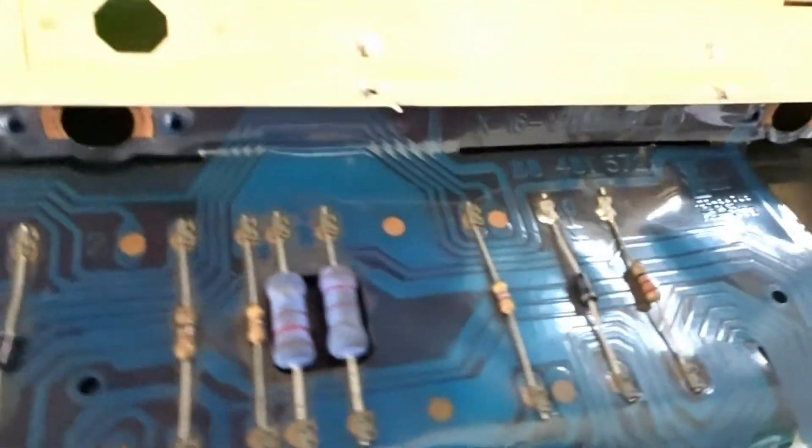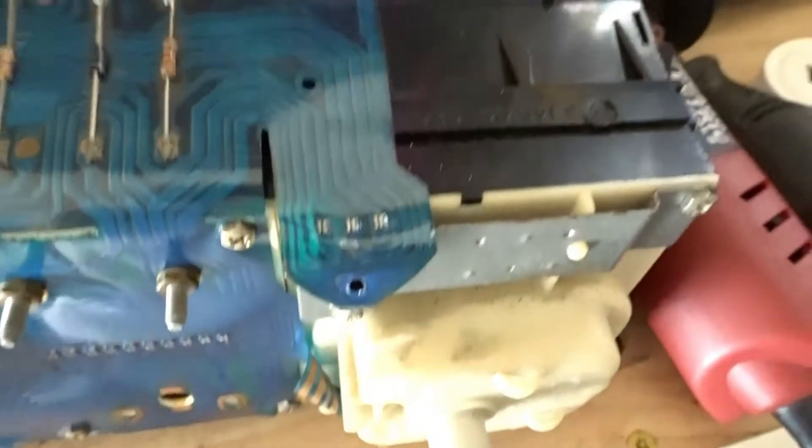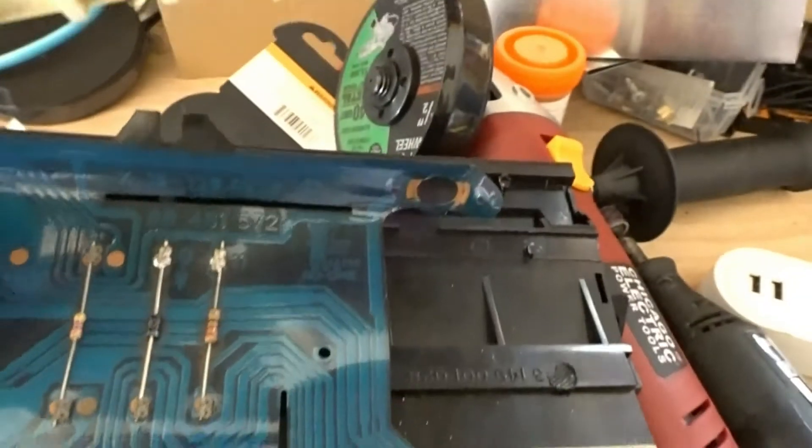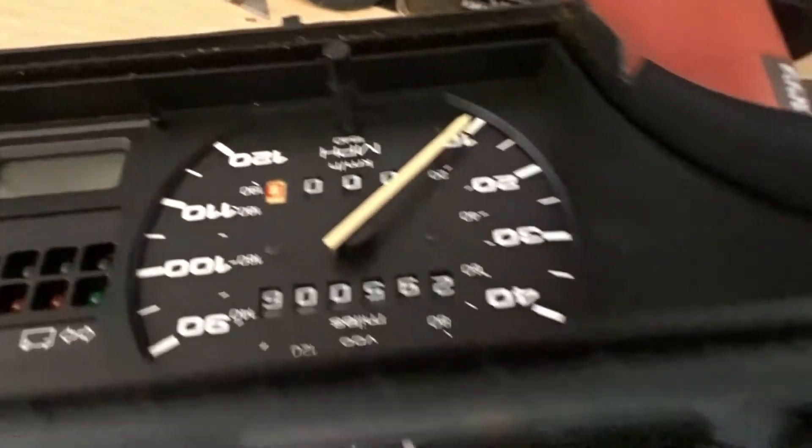We deviated a bit from the plan — we took the top piece off. It comes like this and you have to pop these clips very gently — it takes a lot of patience. The original bulbs go here, here, and here. They are really small — smaller than 194s — so we can't just swap in bigger LEDs. The two bulbs light up here and reflect down to the gauge cluster, but the light is very dim and the LEDs that fit are so small the light won't disperse well to the tachometer and RPM.